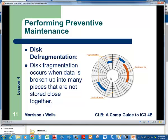So it can start to degrade. Let's say your computer is about 4 or 5 years old. You've never done a defragmentation, and you use a lot of music and video and stuff like that. You could start to see a slowdown. So a lot of times, run a disk defragmentation program that comes with the operating system. It will put things back together so they're all in a neat package. It takes sometimes an hour, if it's really fragmented, to put it all back together.